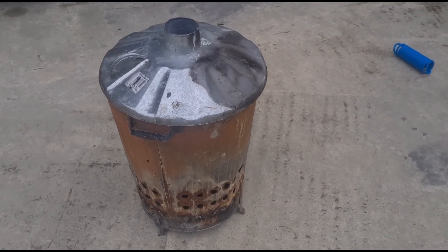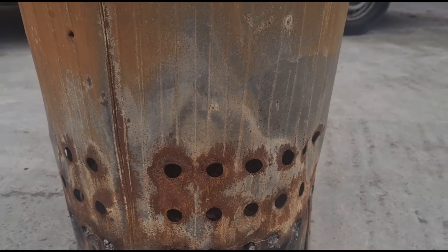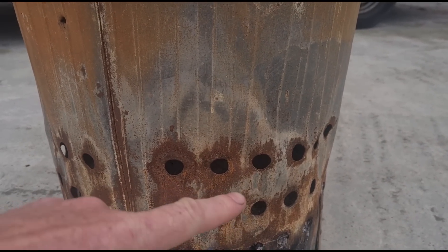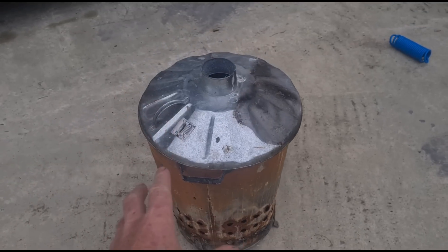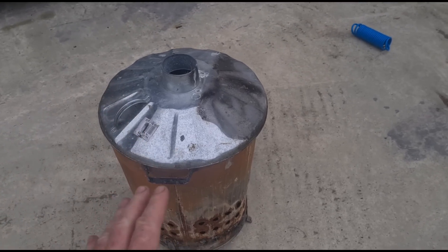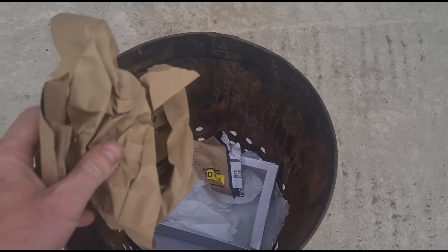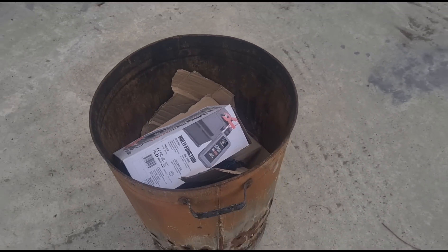What I have here to explain this is a bin or an incinerator — a metal bin. If we pretend all of these holes are the holes in the honeycomb of the DPF filter, then this is a DPF filter itself — this is a particle filter you're looking at. As you drive, it's going to start filling up with soot. So here we are: you're driving, soot is building up, and now your DPF is full.